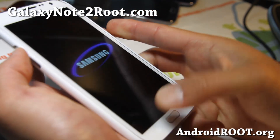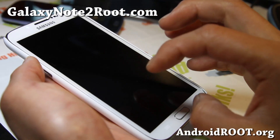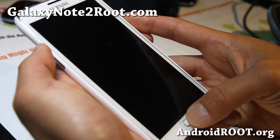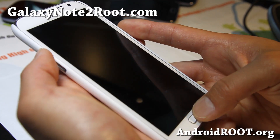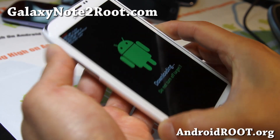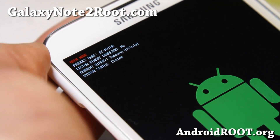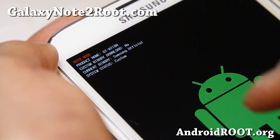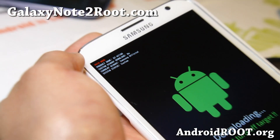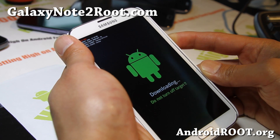The reason is they didn't actually check it. So now it's done — let's go check it, it should say zero now. Power off and go to volume down, center, and the power button. After you run this, you can run the unroot method, which I haven't posted yet but should have it up at GalaxyNote2Root. Hold down volume down again, center, and the power button until you see the warning screen, then hit volume up. It's gone — it says no Samsung official. The system still says custom, but once you unroot and install a stock ROM, it will say Samsung official also.